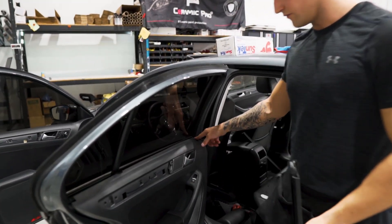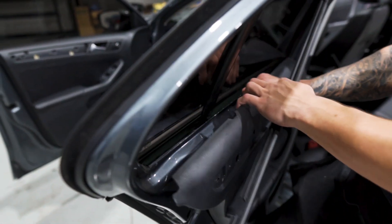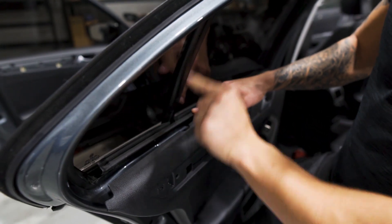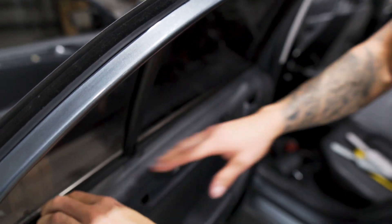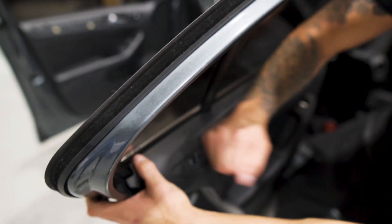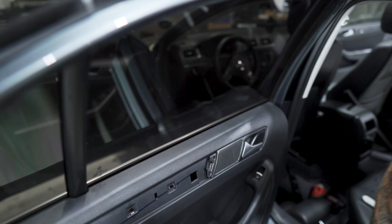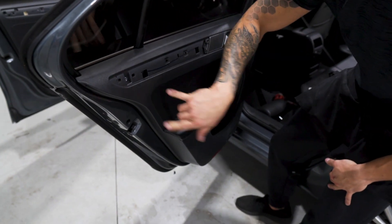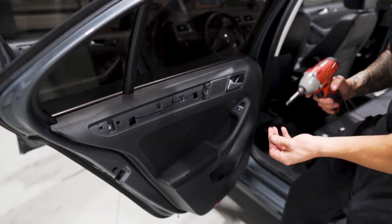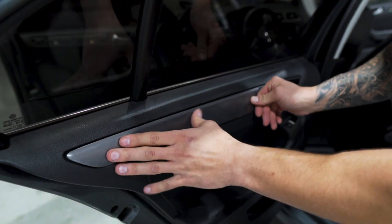With the back door, it's going to be very tight on the front edge. Take the gasket, make sure it's in the right position — the cutout matches up — pull the panel back, line it up onto the channel, and push it forward. Line it up with the rear pillar and push it down into place. To get the door panel back, roll it onto the gasket — push and pull the top back and that'll line up. Sometimes the panel won't click completely down into the gasket, so push it down with your thumbs. Give it a punch or smack to make sure the clip is fully engaged. Put the T30 Torx tip back in and reinstall the trim piece — line it up and give it a tap.